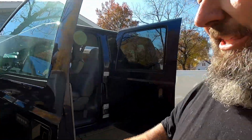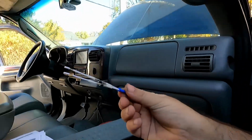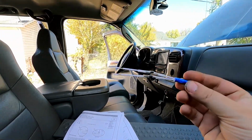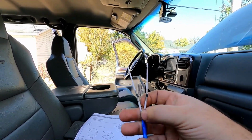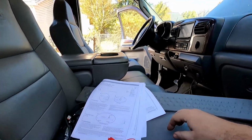So as long as you have this on the truck, then stock, then you don't need to order any extra diodes. The steps come with everything that you need. But if you don't have that keypad entry on your truck, then you need to get the diodes, and AMP discontinued them, but you can go to Summit Racing or a couple other places. I ended up finding them as well. I'm assuming they're just making their own, because it's not a super difficult piece to make. As long as you know what the resistance is in that actual diode, you can just put one together fairly easily.